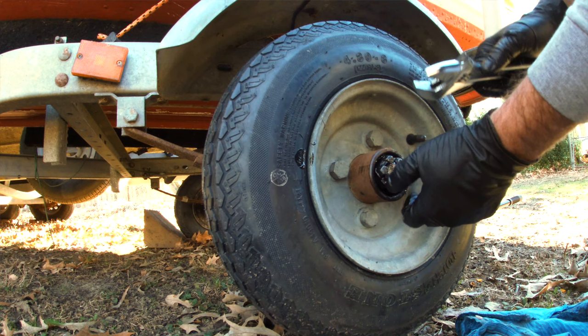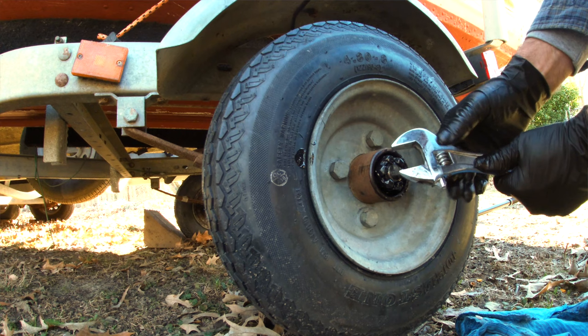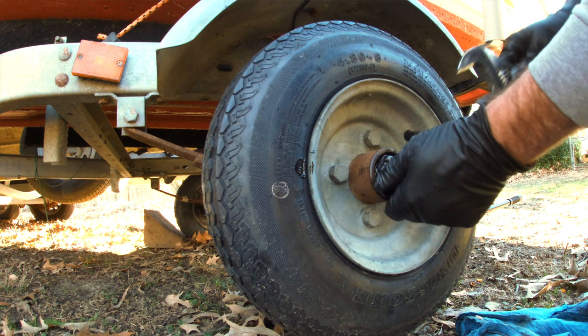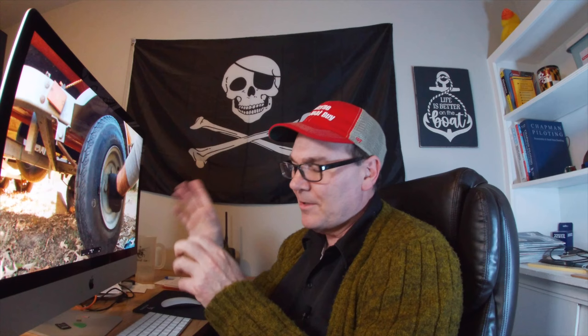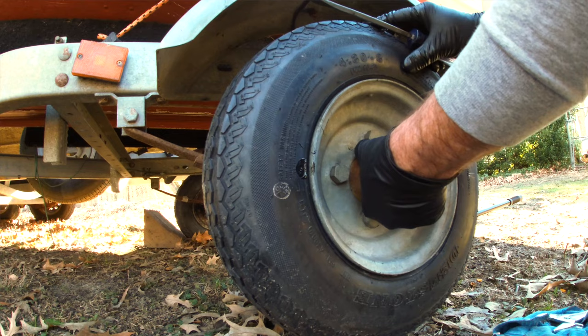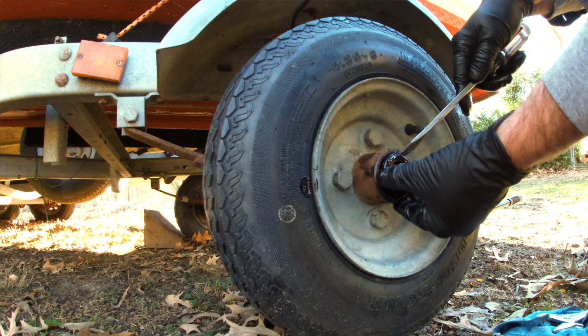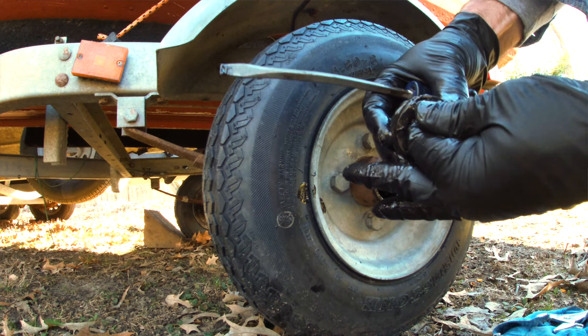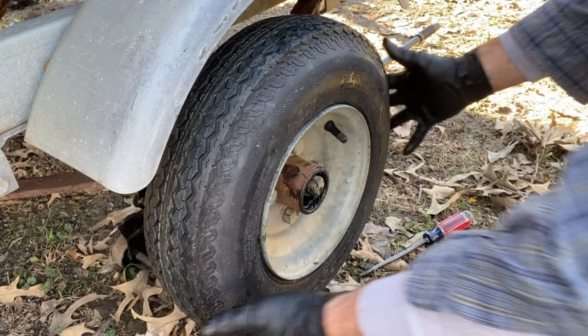If your castle nut's not that loose, an adjustable wrench usually can fit right over these things. We don't want to lose our castle nut because we're going to reuse that. Behind this castle nut usually is a flat washer, but there isn't one — which is interesting because the flat washer usually goes between the castle nut and the bearing. With the castle nut off, we can literally just pull everything off. The next thing is the bearing, which just fits over the axle and between that and the wheel. I pulled out the bearing — that looks good. Now we can just pull the wheel right off of the axle shaft.